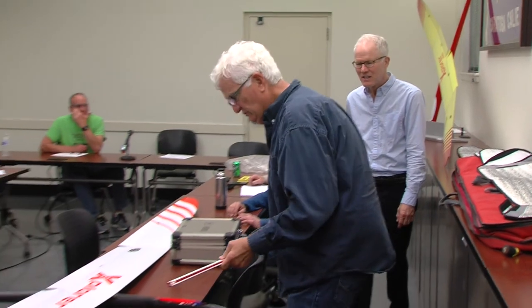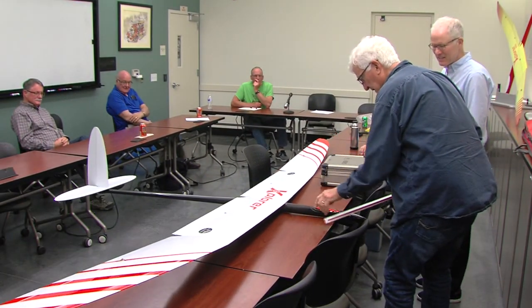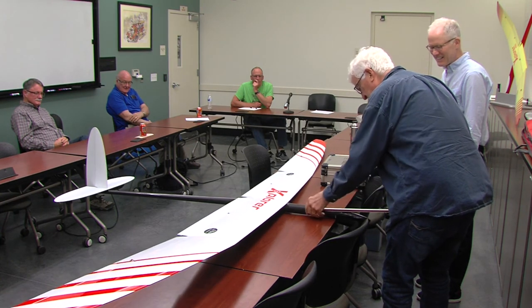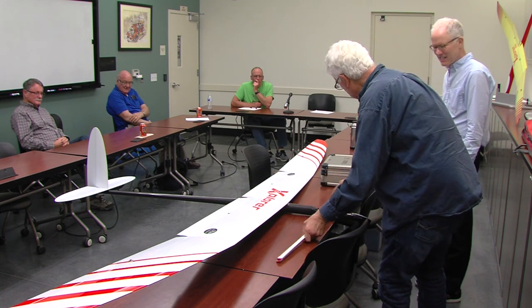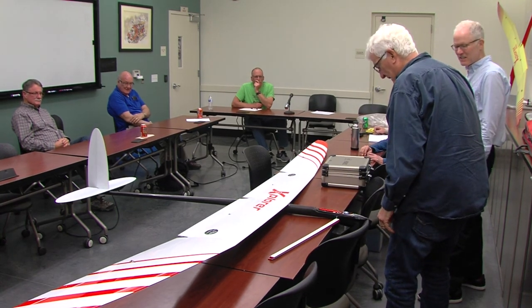And then how do you brace them inside? If you look here, there's a bolt hole right here. These slide in, see how the servo barely fits? These slide in and hit a notch in the back that stabilizes them, and you just screw it in from here. It takes a couple of minutes. And you can do 1, 2, or 3? Yeah, or you can do 4.